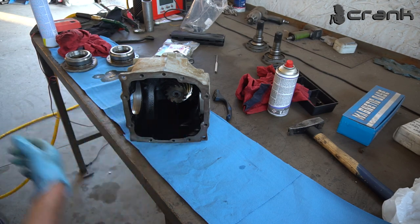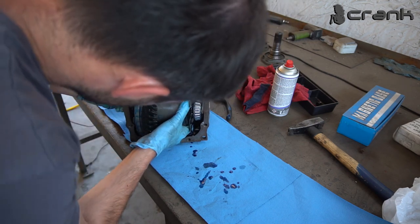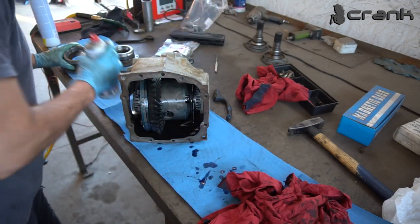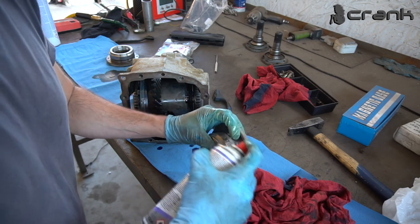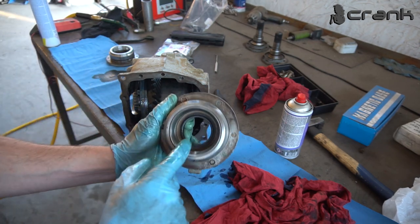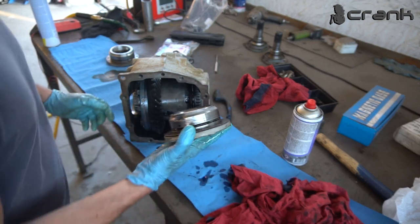So now I'm going to try to put the casing inside. Okay, so let's install it. It should go like that. Like so. And now I'm going to try to install the first axle cap. Okay, I'm going to start with the right one. So let me put a little bit of silicone grease. Like so. I have put as much oil as possible on the bearings, but actually, let me put a little bit of silicone grease here. It should be fine. Like that. Okay, so let me try to aim it.